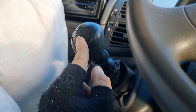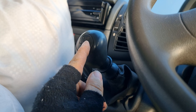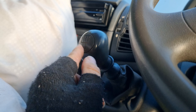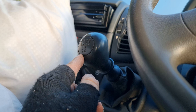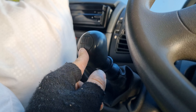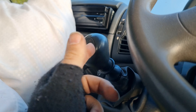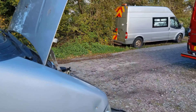When we put the van in 5th gear — this started a little bit after we got it — you hit a grind. When you put it in 5th gear it'll go grrr, like that. Also, 1st is really hard to get into; you always end up putting it in reverse. A common fault with these vans is that the gearboxes don't have enough oil in them. You need to put 100 to 200ml more oil in the gearbox to stop the crunching, because it doesn't get enough oil in 5th gear.